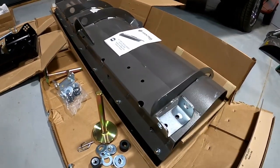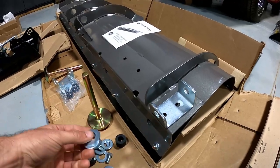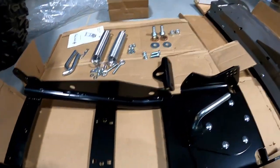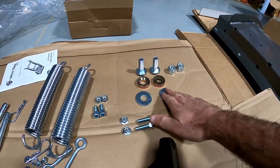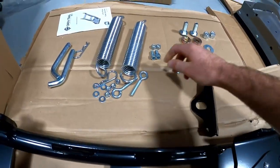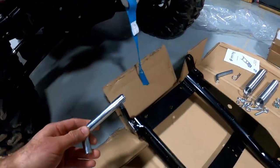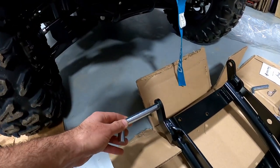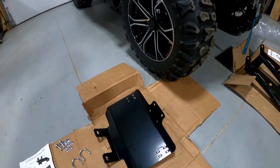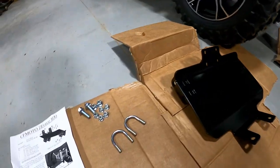With the plow blade itself you're going to get the hardware for the plow shoes. We're going to mount this bracket here, and the plow shoe slides up in. You can set the depth of the plow shoe by stacking the washers in the bottom or the top. The push tube box comes with all the hardware to mount the push tube to the blade. This bracket is what you use to raise and lower — your winch controls this. You've also got your trip springs for when you catch something in the driveway. The pins connect the push tube to the mount. Once we have the mount on the side-by-side, we'll line it up, put the pin in, and put the cotter pin in. The mount piece mounts directly to the bottom of the side-by-side, and this is the appropriate hardware for that.